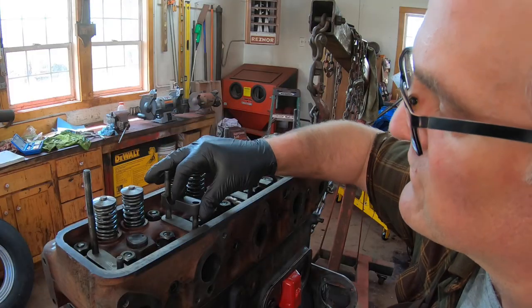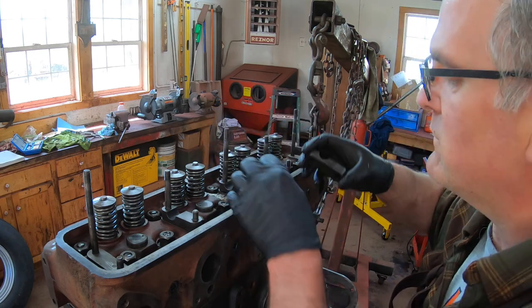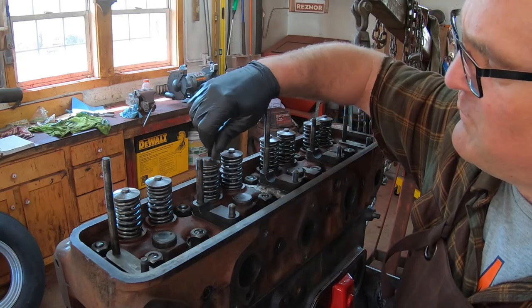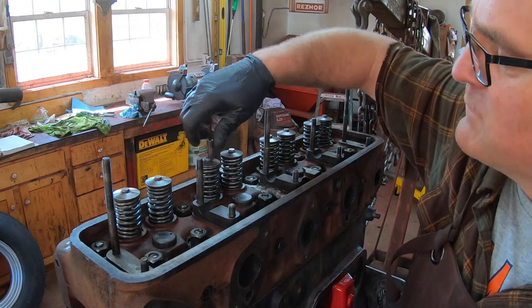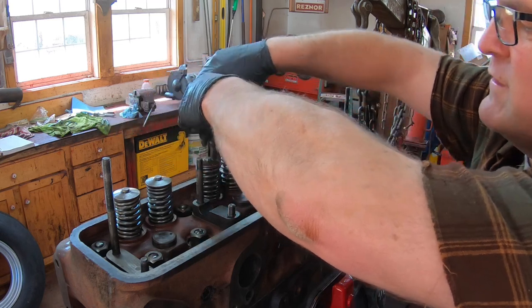These three rocker arm supports go in the middle three studs. And this standpipe is connected to the breather on the outside of the engine over here, which runs up to the intake side of the air cleaner. It ventilates the area under the valve cover.